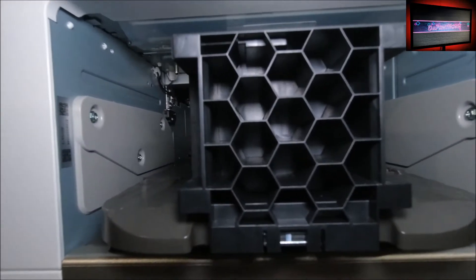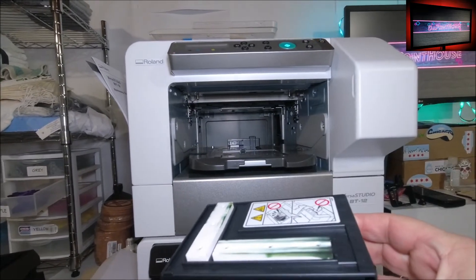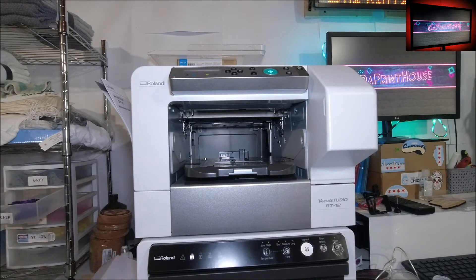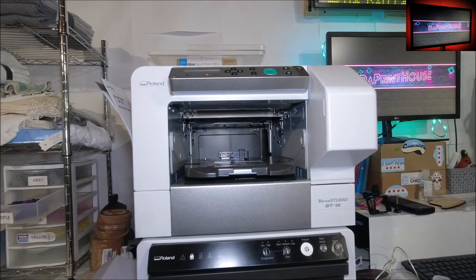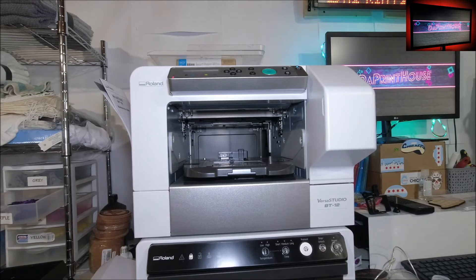We're back - it's done. It's gonna have you take out your tray. If those pads are pretty dirty and this is your first one, throw those out. I only reuse them after the initial because the other side is clean. Put everything away, put your tray back in because it's telling you to - press start. It actually might do another maintenance by itself, so don't put the tray back until it tells you. It's just doing something with the heads, then it's gonna say 'put tray back in.'